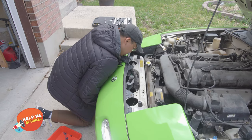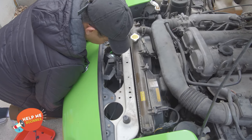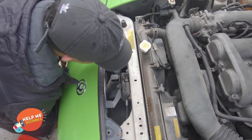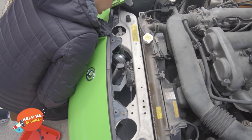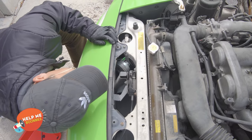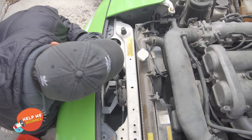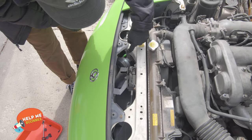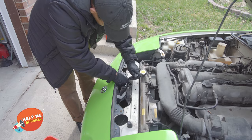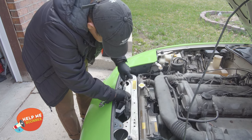So what we have to do is take that out, disconnect it, and then swap it in with the new one. There is an electrical attachment — basically the plug in from the car — and it looks like it's the green wire here. It's just a push in and then pull; make sure you don't rip out the wire. The problem with these old components is the plastic is so old it could break. But I got it disconnected. Now we can just remove that — I'm going to guess it's a 10 millimeter as well, and it is.